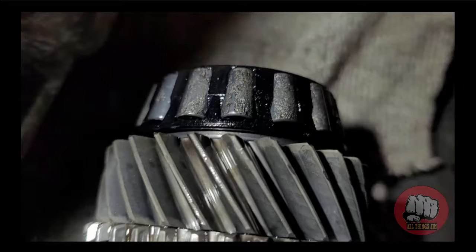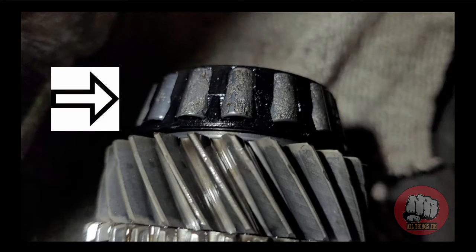Next I'm going to bring you over to where the actual gears are and show you this top bearing here. For some reason Ford and other manufacturers in their infinite wisdom decided to make this top bearing casing in plastic. Whether there's too much play in it or not, it always goes. As you can see, the roller bearings are actually very badly pitted, which is where quite a lot of the swarf has come from.